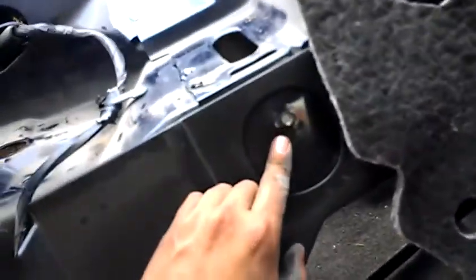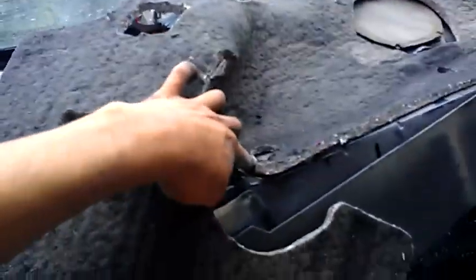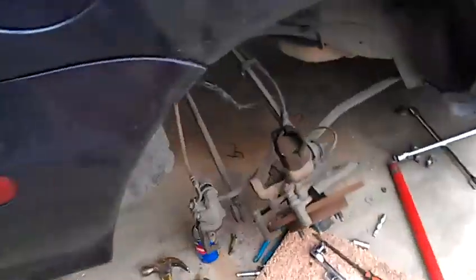It's not that hard. You've got one bolt here, two here, and the same on the other side. Then you've got two clips up here, and that takes this part off. Then you've got to remove your speaker cover. The rest is just basic strut removal.